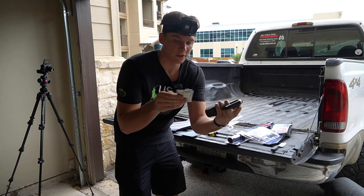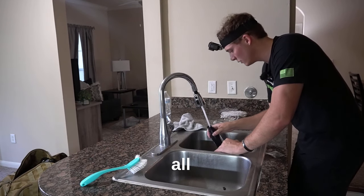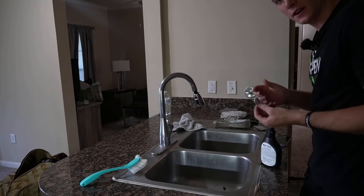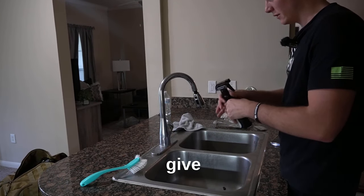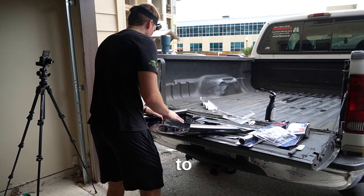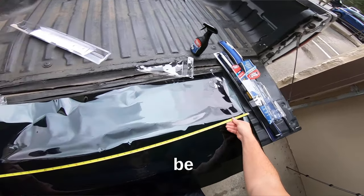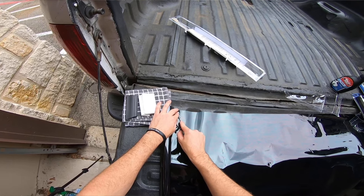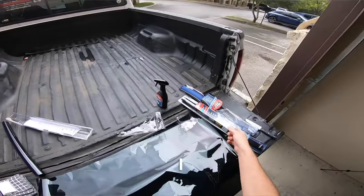What you have to do is take your gel solution and mix it with 16 ounces of water in the bottle — fill it pretty much all the way. We got the gel in there; the packet was hard to get in but we got all of it. Just give it a little shake and we should be good. It comes with two packets. We're going to measure three feet three inches — that three inches really matters. It doesn't need to be perfect because this is just the initial cut. I got a little bit of extra film, that's why I bought a second one.